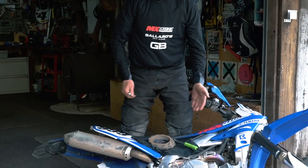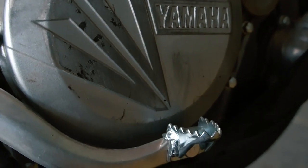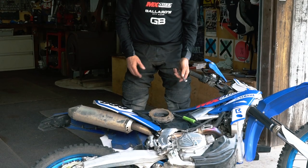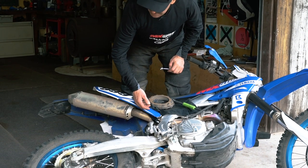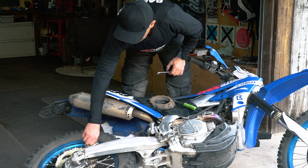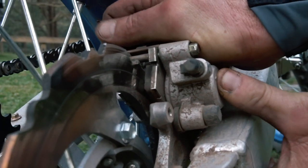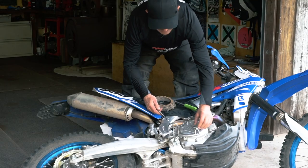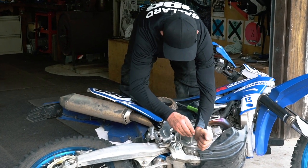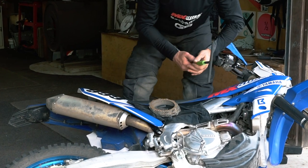One of the tricks: instead of taking the brake pedal off, you've obviously got to take the access cover off. On the old bikes you didn't have the luxury of this little cover — you had to take the whole side cover off. So one trick is to spread the rear brake pads by pushing on the caliper. That gives a lot of free play in the brake pedal, so instead of it blocking the cover you can push it a long way down and jam a spanner in at the bottom. Now Sage is taking that off.